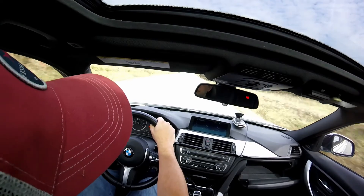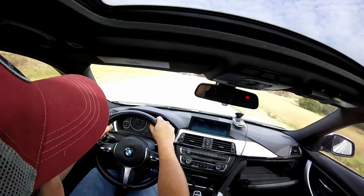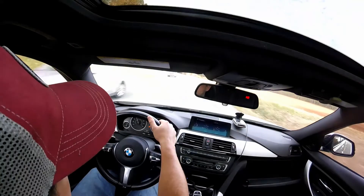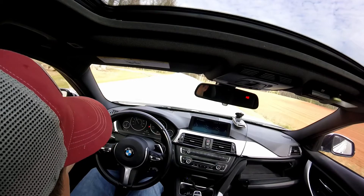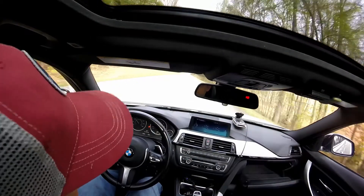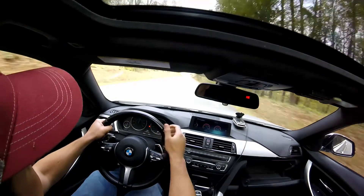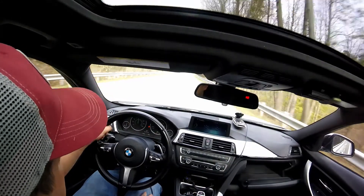I'm going to keep going down this road and hit one more before we go back and edit this video. Hopefully we got over 21.9 psi on the same map — my tuner at this point is going to be able to turn the boost up and the car will effectively be able to read it. Starting the log, getting it down to about 2500, floor it. Feeling really strong. Stop the log.